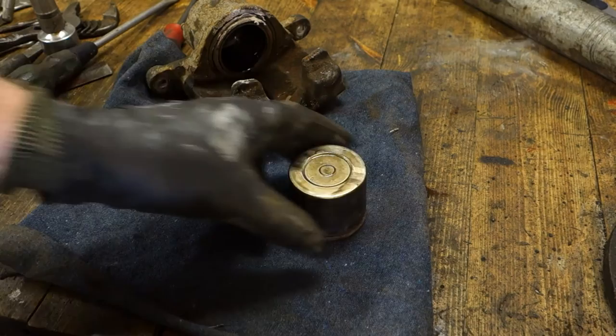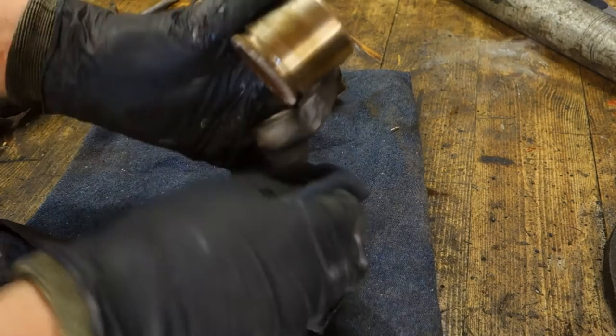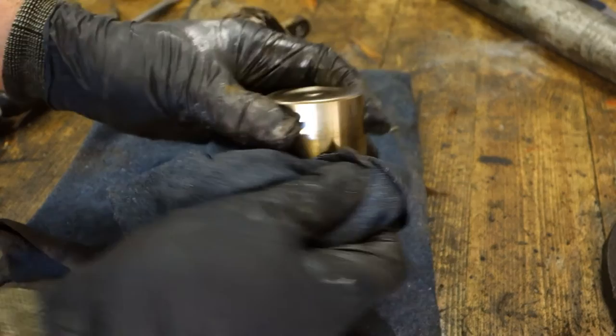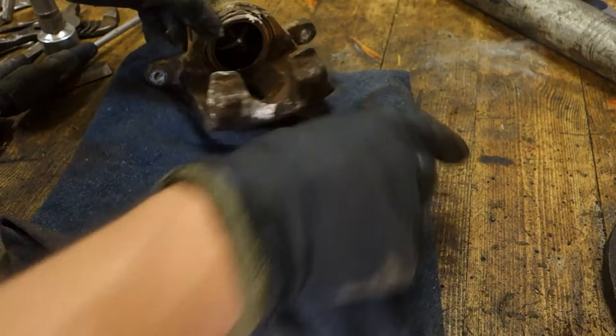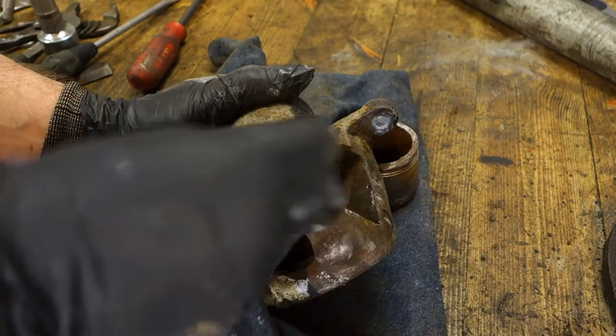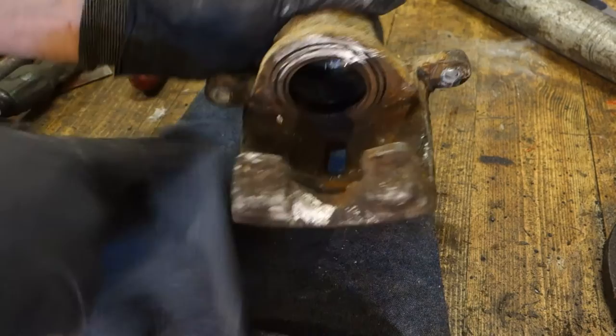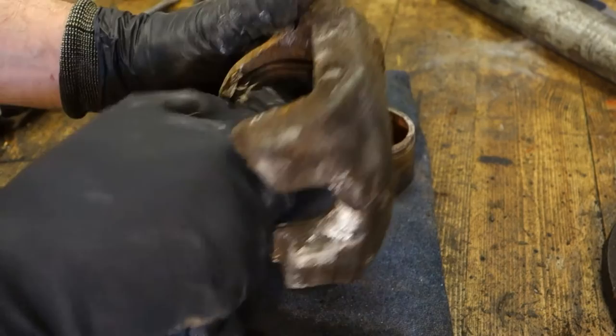Okay, and then I take a clean cloth and I clean this piston very carefully, all these areas, and I check whether there is something rusty, but in that area this looks good. The purpose is to clean it totally clean, and also I clean that inner area in here, and I check that there is no rust and no wetness in there. Okay, and then I check the inner piston cylinder areas that there is no corrosion. And then when this is clean, I insert specific lubrication.